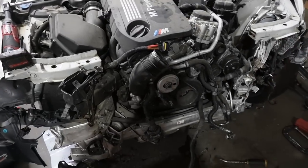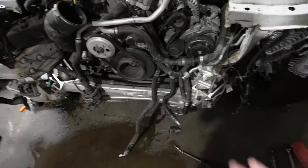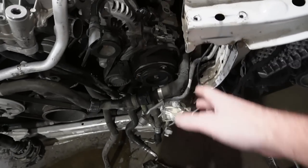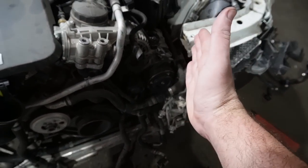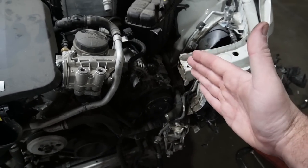After stripping a lot of stuff off the front of the M4 CS, it's honestly looking a lot better than I thought. The frame rail itself — I still need to remove a few more things — but it just looks like a slight bend to the front, not buckled inwards. When it's a slight bend, that can get bent back, which would be pretty awesome.